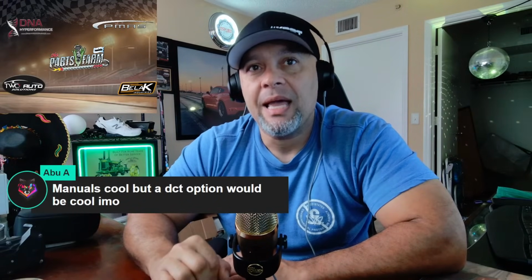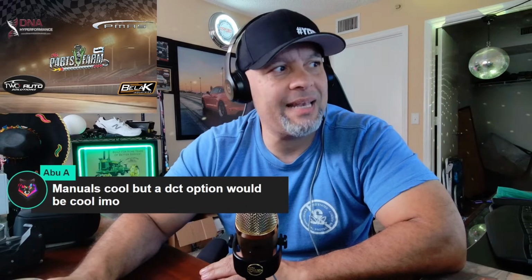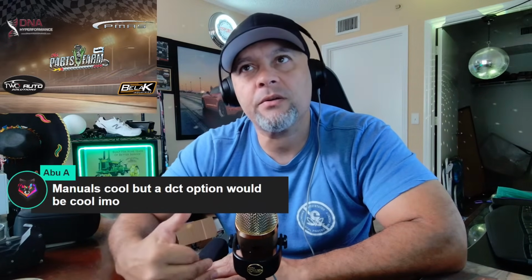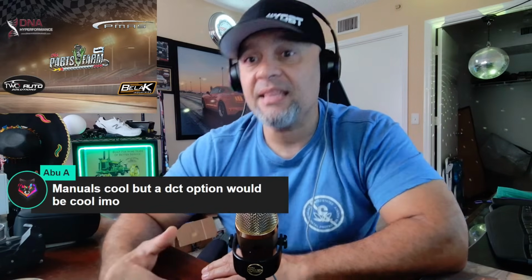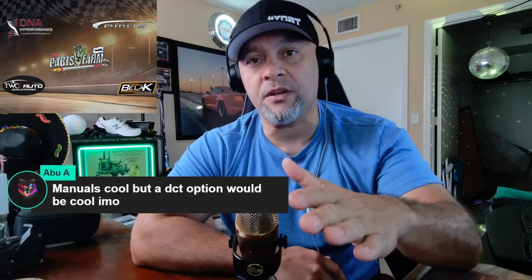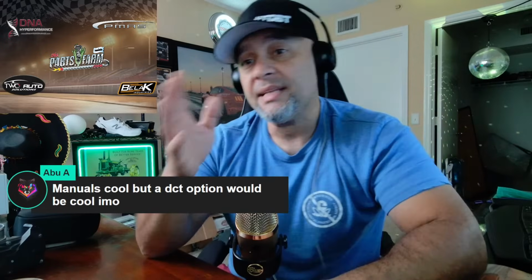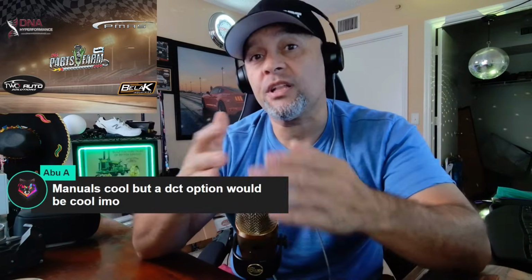It's been almost since 2018, so it's been almost 6 years since the 10R80 has been introduced. And it's been sevens a couple of times, but those transmissions don't last long, and that's okay. But I just don't think it's there compared to the 6R80. The 6R80 hard parts need to be upgraded because the clutches and the clamp force is that good. Jake explained it in the video that we were talking about. He's like, I think the clamping force is so great in the 6R80, hard parts fail. 10R80s don't have enough clamping force to break stuff, so the clutches slip.